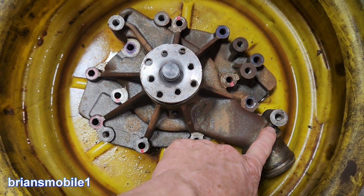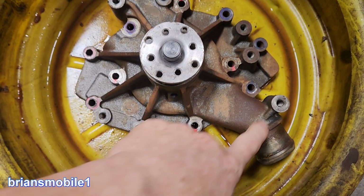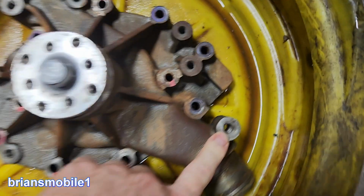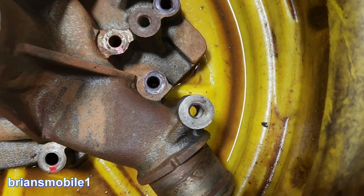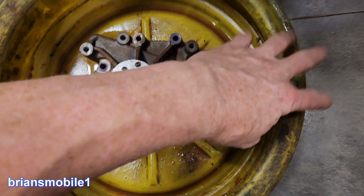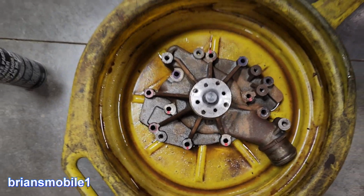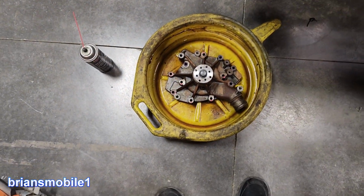This is the one that's kind of the odd duck on the AC compressor and power steering pump one. This one's a stud, it's short, and it's a blow-through hole. Basically, you can use a longer bolt if needed there. And then the other 4 on that bracket are all the same. So that's it in a nutshell. Hopefully this is helpful to you.